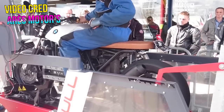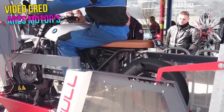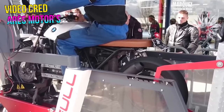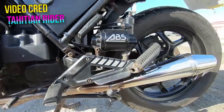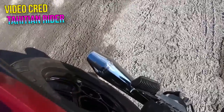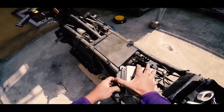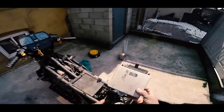After that, all US models received the California cams, meaning the whole country lost about five ponies. With the shaft drive system sapping close to 20 horses, you're probably putting down somewhere in the 70s to the actual pavement. The K75 was rated at 75 horsepower and is likely putting around 50 to the pavement, since the drivetrain is the exact same. So with the 8-valve K100 and all K75s, fueling is controlled by the Bosch Jetronic fuel injection system.